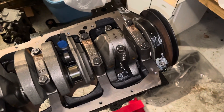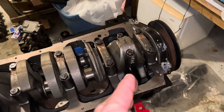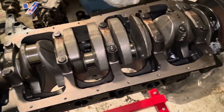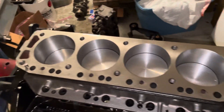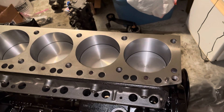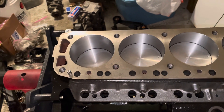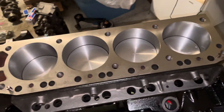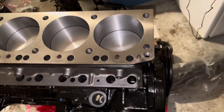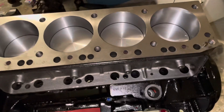I'm not going to show the other three pistons being installed because it's just repeating the same process — tighten and torque them all up. All four pistons are now installed in this 3.0 liter Mercruiser engine, and the rod bolt nuts are all torqued to 45 foot-pounds. I've rotated the engine a couple of times — it's a bit odd how it spins freely when the pistons are at top and bottom of travel, then gets harder, then spins freely again, but that's normal.